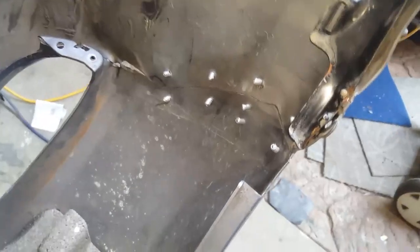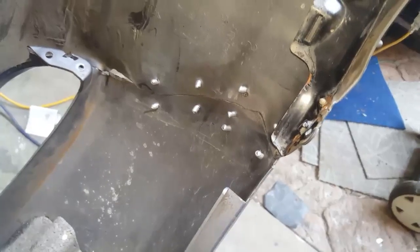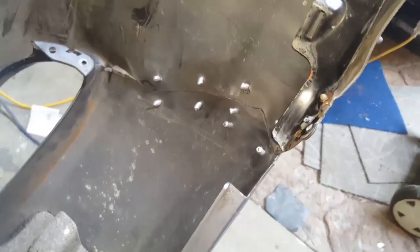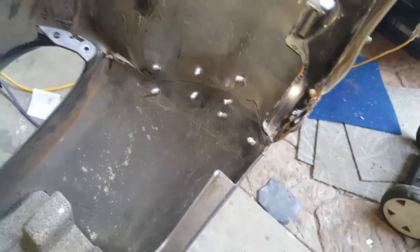Because the bumper's going to get soft in the heat and so forth in summer, the bog's not going to stay where you put it forever. The bog is not something you want to use on here. It's got to be fiberglass or plastic, something that's going to be able to heat up and be flexible with the bumper.